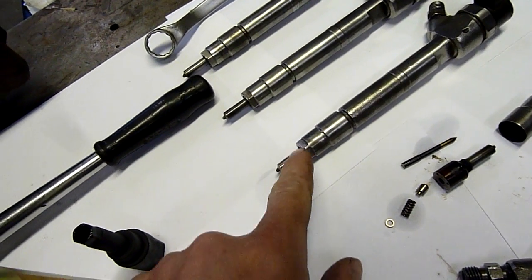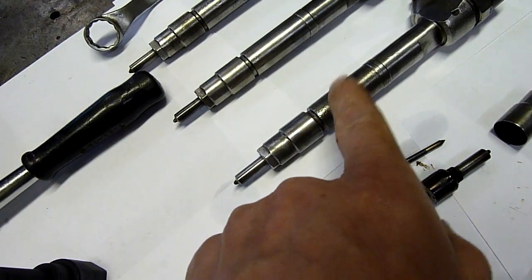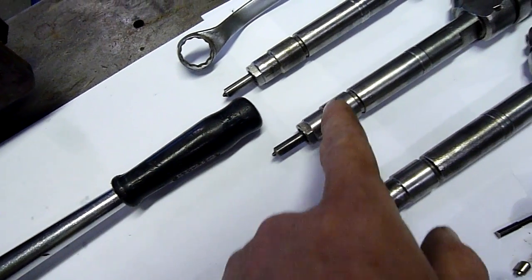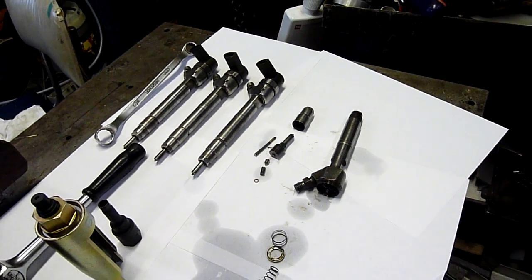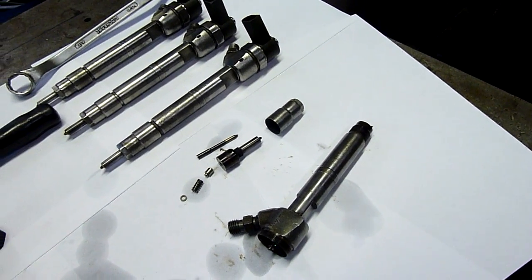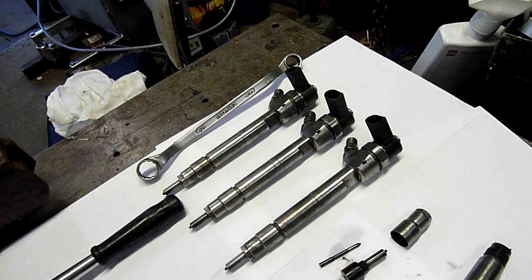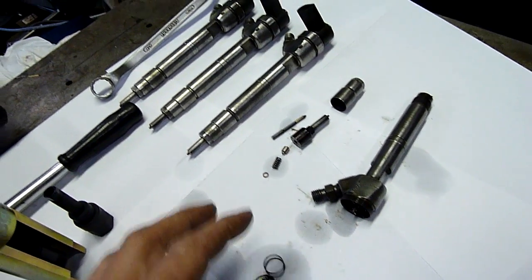That one's been serviced — nice clean, almost pit-free tip, fairly recent cap, but pitted body. That one's suffered from the black death but they've sent it off to the shop. That one there is fairly pitted, had its day, but still not too bad. That one looks a bit cleaner — they've spent a bit of time in the shop. They'll go off to AG Diesel and get flow tested, cleaned, and all that sort of stuff — they'll make them nice again. This one here I might throw in for the hell of it, but I don't want to pay a hundred bucks just to be told what I sort of already know — that it's rooted. If the cost is fairly expensive I won't even bother sending this one in; I'll just send those three.